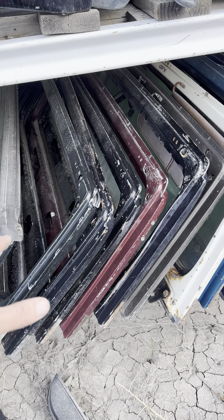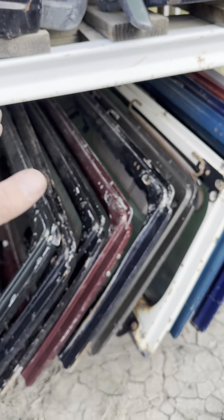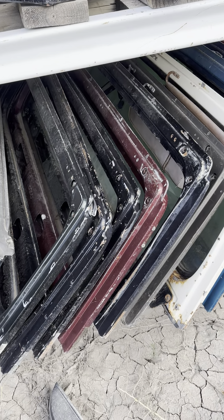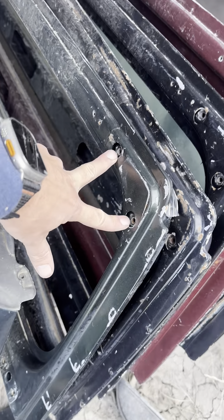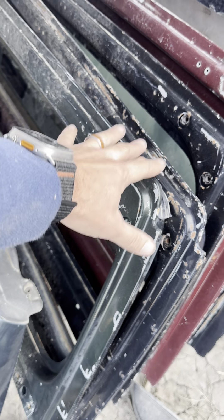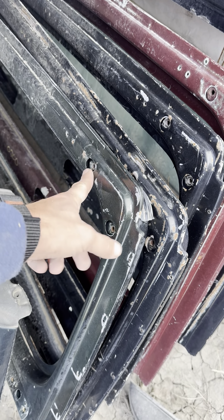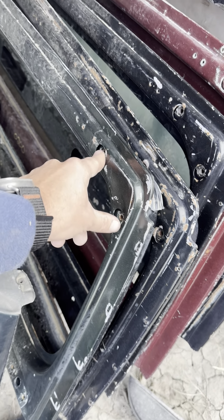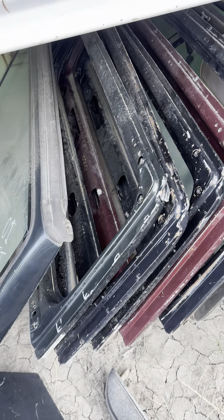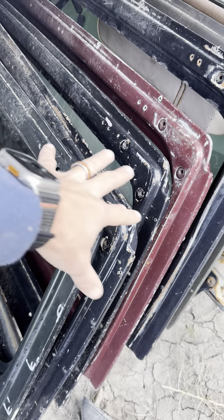We're going to have a lot of YJs. Most of these are all YJs. The easy way to tell a YJ from a CJ — because they're going to look similar — is the extension bars. The CJs didn't use extension bars. So if you've got an original YJ windshield frame, you're going to have those. They're in the top right and left corners — they're the roll bar extensions, added in the later years for safety.